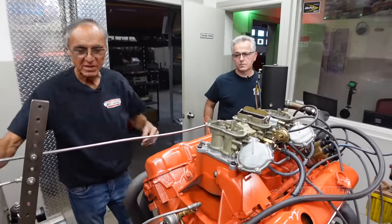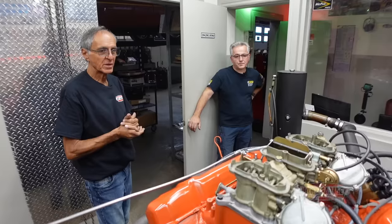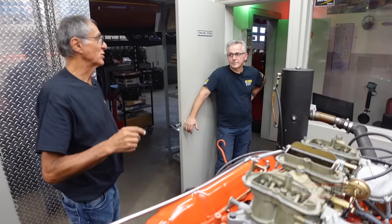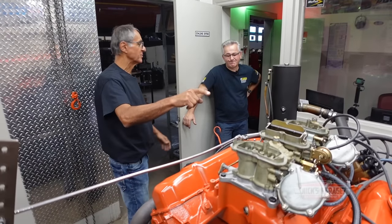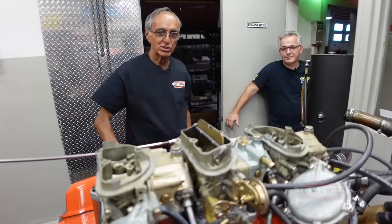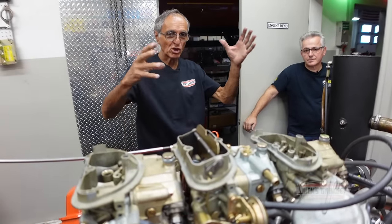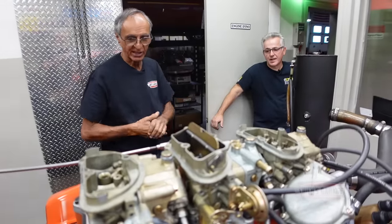But you know what? I'm trying to bring the RPM slowly up for the stumble. But I like to have it richened out a bit. Maybe we should change, but changing the jets on this is not easy. And there's no jets on the outboard carburetor, there's only metering plates. But in the meantime, if we go with the exhaust manifold, it's going to run a little bit more on the rich side. So let's leave it for now.